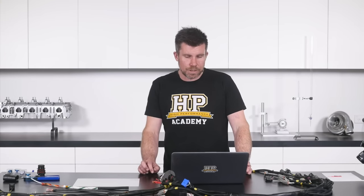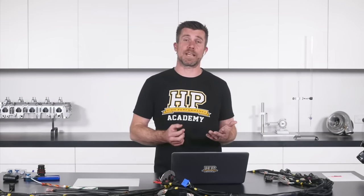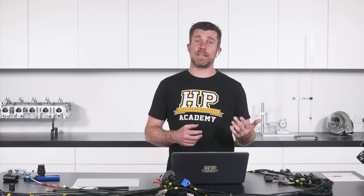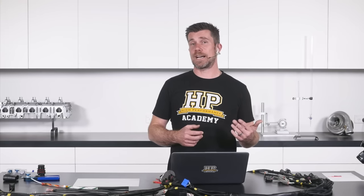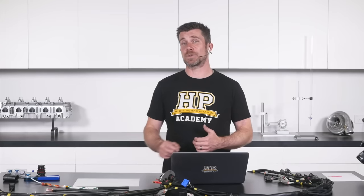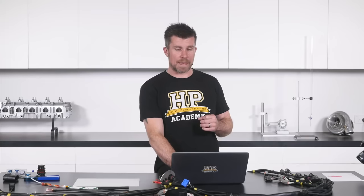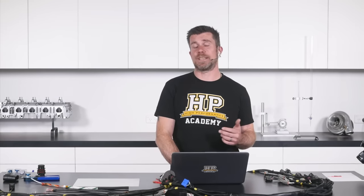Doing Stuff Daily asks: should shielded wires all have the same direction twist? Assuming you're talking about concentric twisting: shielded cables are specific manufactured wire — a shielded pair will have two conductor cores twisted together with the shield around them. Beyond that it's not critical — the twist direction in concentric twisting has no effect on the ability of that shielded cable to reject electromagnetic interference. What matters is that the shield is grounded at the ECU ground so it can drain away any EMI, protecting the conductors underneath and ensuring signal integrity.